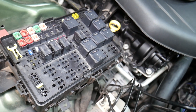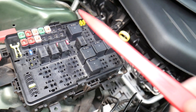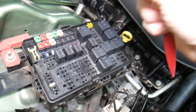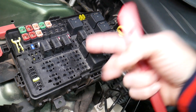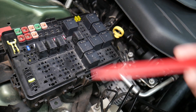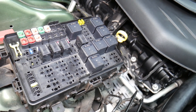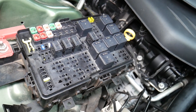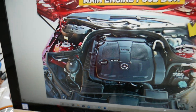If you're not qualified and certified to work on the airbag system, I would never recommend doing that. When disconnecting the car battery, a common mistake people make is not knowing which terminal to disconnect and reconnect first. If you do it the wrong way, you can burn electronics modules. We know because we burned a traction control module on a BMW — that cost two thousand dollars. We'll put a link in the description below on which battery terminal to disconnect first.